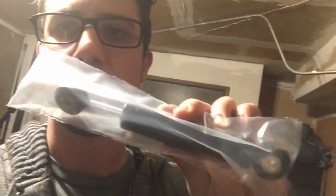So my next option was to get this tensioner shock, which is very common on these cars. Before I take out the diff and change it, I'm gonna work on that. In this car right here, I'm gonna take out the diff. The welded diff is not that it's no good, but I just don't like it for dailying. I have a brand new rebuilt 3.23 LSD that I just rebuilt, so I'm gonna pop that guy back in this. Yeah, this is how it goes.